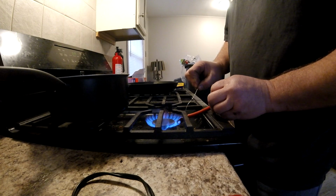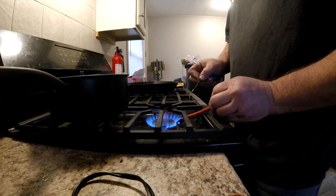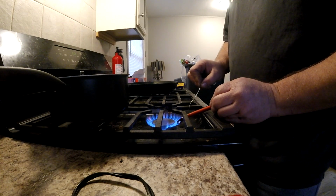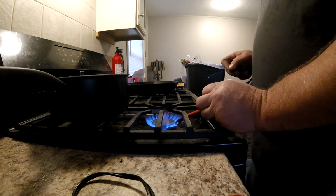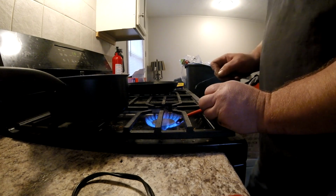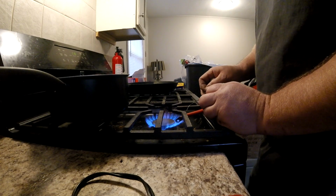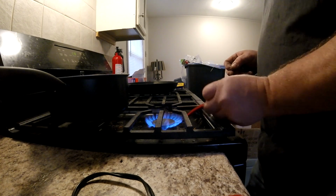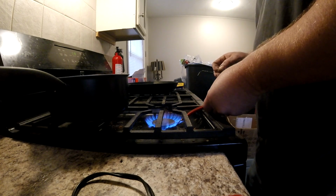Get it off at an angle where you can get just the lug hot, and then as the lug heats up, you can feed solder into the joint. This could take a couple minutes. Be patient with it. Don't be pushy. Give it enough time to let this lug really heat up. That's why you'd never do it with a soldering iron as efficiently.